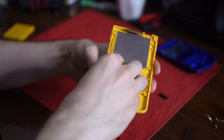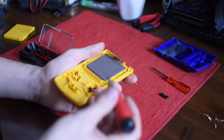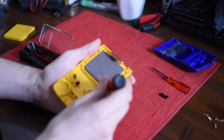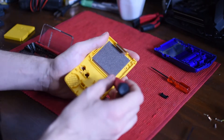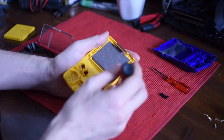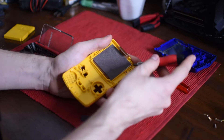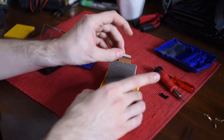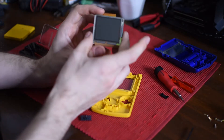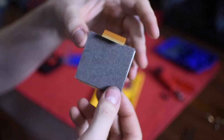All that's left in this casing is basically the screen. If you want to take the screen out, what I suggest is a very small flat-head screwdriver — just work into the corners and very gently apply pressure to each corner, and you should pretty much just be able to lift it right out. That is your Game Boy Color screen. This is more or less how you would go about installing a new screen if you want to do so, though that's not what we're doing here.